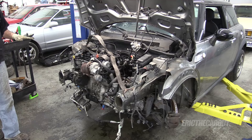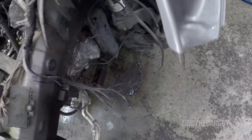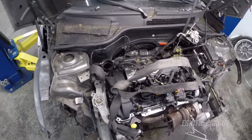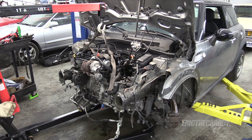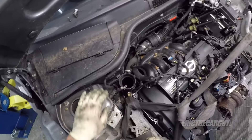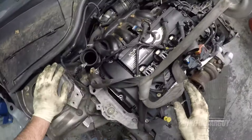We're ready for the engine hoist. Now we're all set with everything we need for removal. Areas of concern are this AC compressor and its lines and getting around it. Also, the clutch hydraulics are right in this area and look like they could get smushed. I believe everything is disconnected. So let's cross our fingers and hope we got all that. Also, this wire for the alternator's got to get fed back through. First thing I'm testing is how the seat belts are doing — if there are any areas of concern, any knots not looking good, any wires getting pinched. There's a lot going on here, so we just work slowly, carefully, methodically. Should be all right.